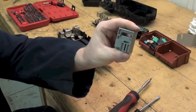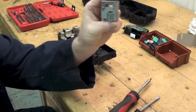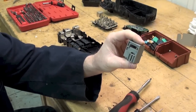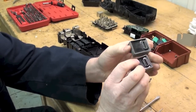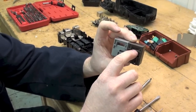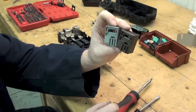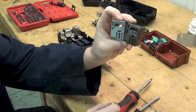Here we are with the reassembly. This is the old ELD and this is the new one I purchased. This is not available through Honda — they want you to change the whole unit to get this one piece. I went to the dealer and matched it up with one from a 2002 CR-V. They are identical. The only thing that is different is the area where the bus bar goes through, which is actually smaller on the new one. The brown one is the new one, this is the old one, but I am pretty sure it is going to work and fit our bus bar. We are going to put it all back together today and hopefully it works.